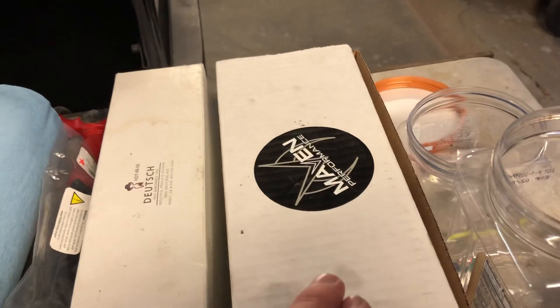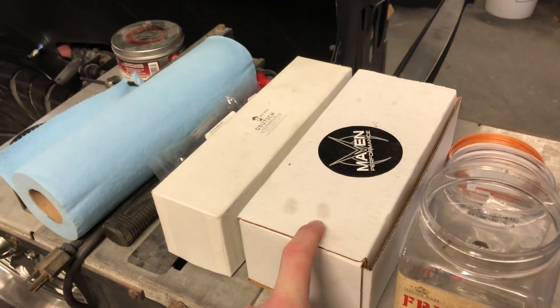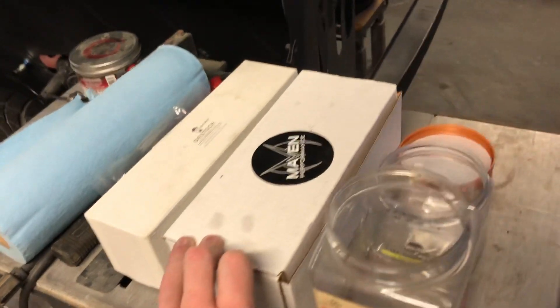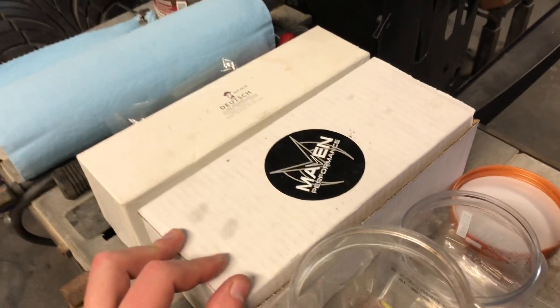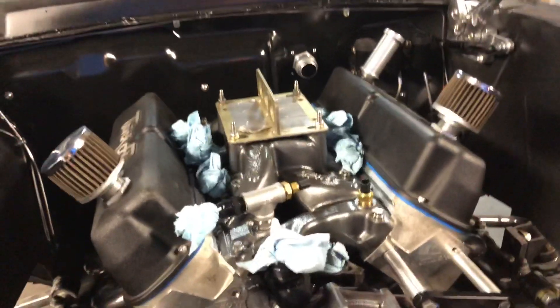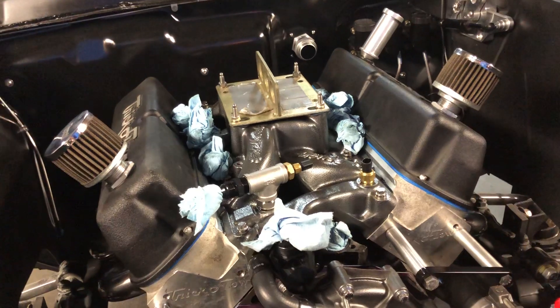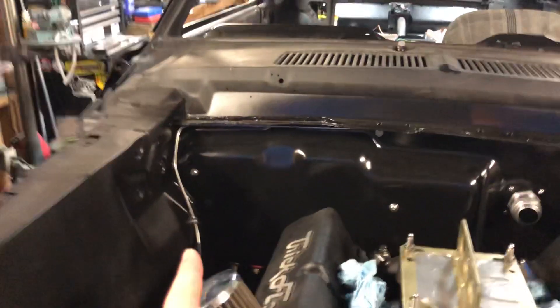On to the mistake: more is better. I got this 29-pin and roughly drew out what I needed to feed into the engine bay. I figured 29 pins was plenty — and for a carbureted setup it probably is, no issues — but if you're doing EFI, get their double bulkhead, get two of these 29-pin connectors, probably, because one thing I already had to do was put the Hyper Spark inside or under my dash.